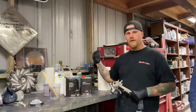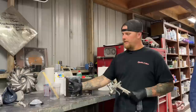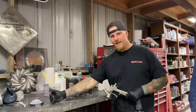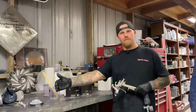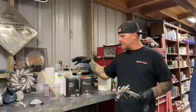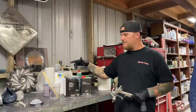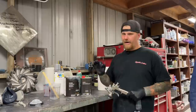The price is pricey — you guys are going to freak. But if you are using the normal standard where you buy an epoxy primer, then do your body filler, then buy a polyester, then buy a urethane at the end, you're using several different products to get to the end result — which becomes confusing, especially for the guy starting out, and if you had a failure in any one of those products you wouldn't know where it occurred. With this, you're narrowing it down to just this primer and body filler. The amount of money you'll actually save by not buying four other products and buying one very high quality product is a huge benefit.